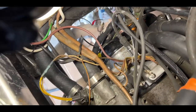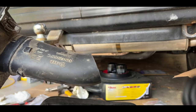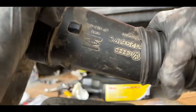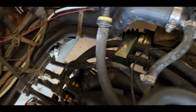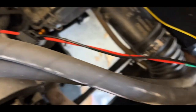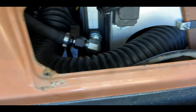I just finished routing the hoses. They come off of the adapter down there, then they go into the clamp right in there, come around, and then into the oil cooler. Modified and cut off the end of the intake so now it can be attached to this hose. This flexible hose will go over to that side pillar. Everything's installed down there, hoses are run through, that's the clamp they provide, and I zip tied things down. The air intake tube is now put together — it snorkels through and goes into the pillar.